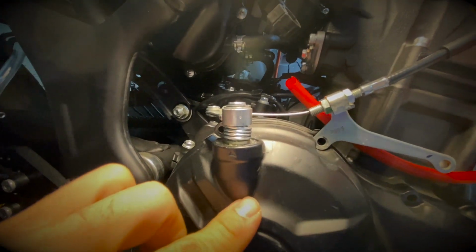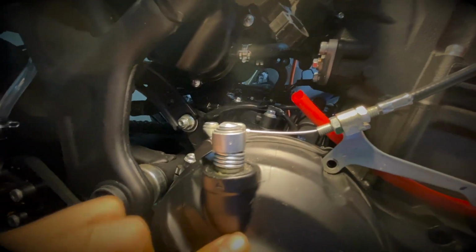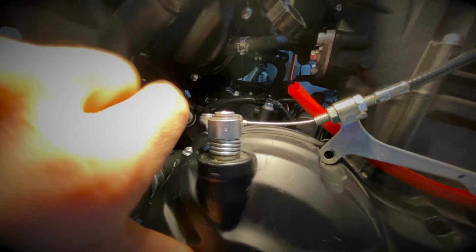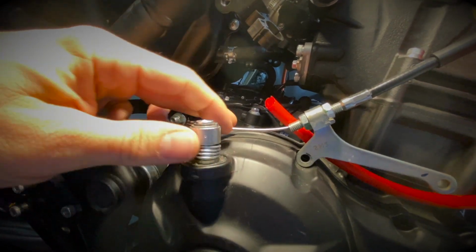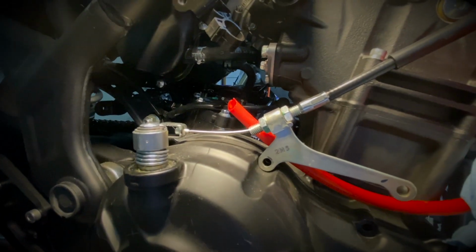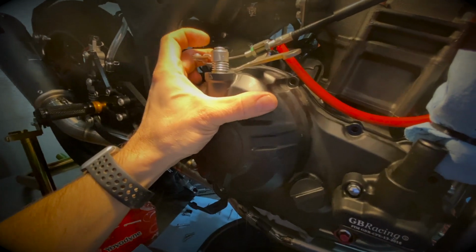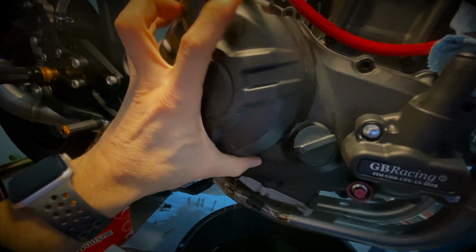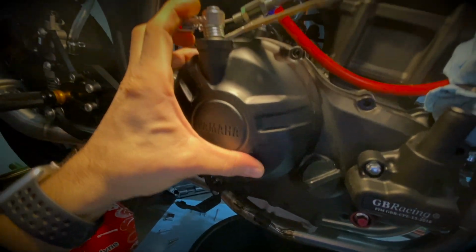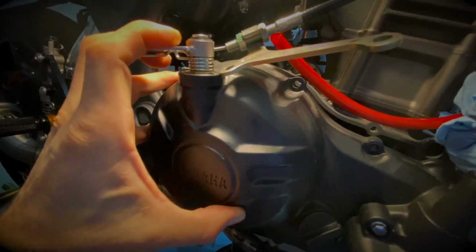And then the next step is to remove the cable arm and swing it backwards. You have to turn it towards the back of the bike in order to remove it. Normally you turn it left and it will disengage from the push rod. You can see here I've just pushed this backwards and everything's coming in. There's still a bit of oil dripping there. I'm going to slightly move it back and see if it comes out. I might have to turn this backwards a bit more, and you can simply wiggle it slowly until it comes out.